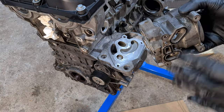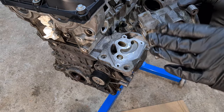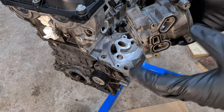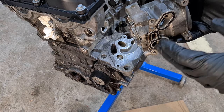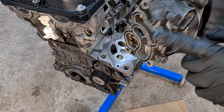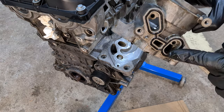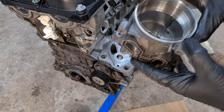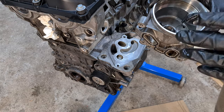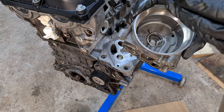What happens if you get debris inside the oil filter housing? If the oil pump sucks debris past the oil pickup mesh screen, the debris passes through the oil pump where it usually gets further ground up, then gets into the oil pressure regulator valve and up into the oil filter housing. It then passes the check valve and enters the oil cooler, going through this port and ending up back in the oil filter element chamber where it gets filtered out. If you see debris in the filter element chamber or in the oil cooler and drain passage, you have a problem.